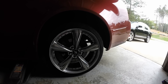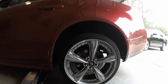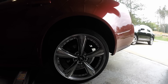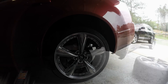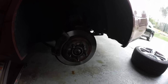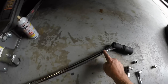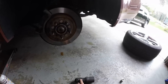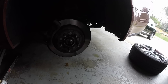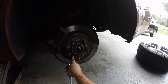So I'm going to go ahead and get this changed. First thing is I have to take the wheel off, so I'm raising the car. Once the wheel is off, we'll start with removing the brake caliper and brake rotor. You're going to need a huge breaker bar to break the axle nut loose — 36 millimeter — and the longer the breaker bar the better. This made quick easy work breaking it loose. You're also going to need a T30 to loosen up the screw for the brake rotor.